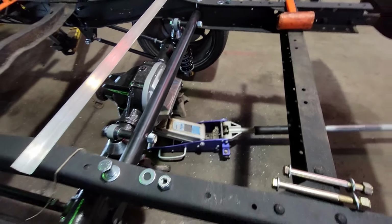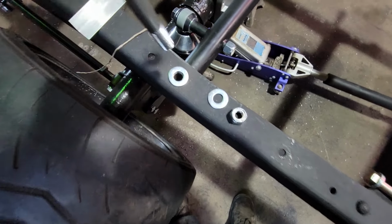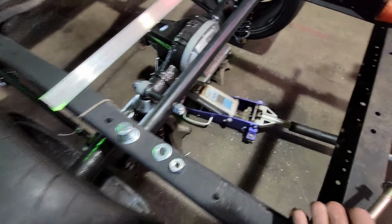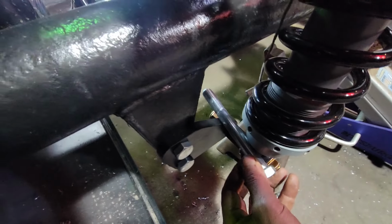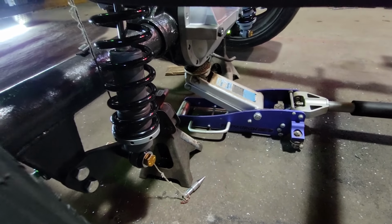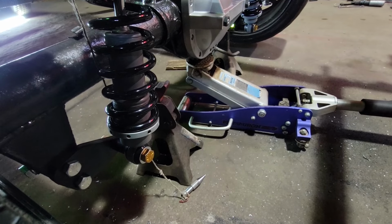Also, to start, the instructions show that this takes these 1/2 inch bolts. Well, them sleeves in there are 5/8, so I'd imagine they changed their kit at some point. And it kind of looked like these bolts were intended to go in the lower shock bolts, but stick them in there and you can see that they're much too long for that location. So while the power was out, I went and bought a couple grade 8 bolts from the hardware store. And these must be plated with real gold because they were $6 a piece.